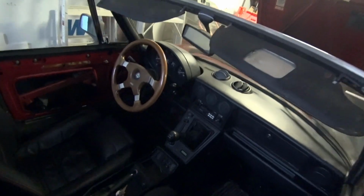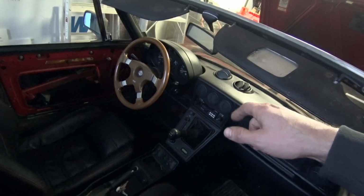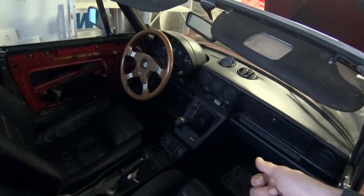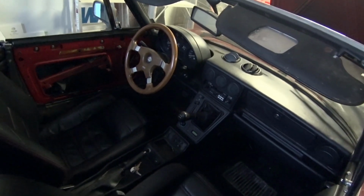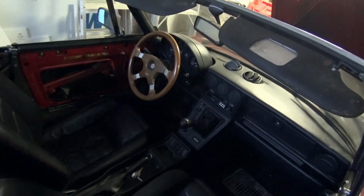The high pressure fuel pump wasn't coming on. So typically you turn the key on, it momentarily sends power to the fuel pump. So I had my son cranking, because while it cranks, it'll send 12 volts to the fuel pump. I was checking power underneath there with just a cheap multimeter. I'm not getting any power there, so a little frustrating. I figured I wasn't getting power, but I had power everywhere else in the relays where you should.